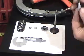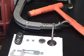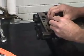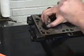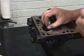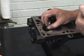The next thing that has to be done is using an appropriate small hole gauge to position it directly into the valve guide on the engine. Once we position this, we're doing a very similar process — we're checking the valve guide top, middle, and bottom of the position and comparing it to the average top, middle, bottom reading of the valve stem that we've already established through measurement.